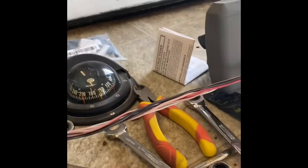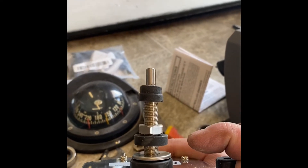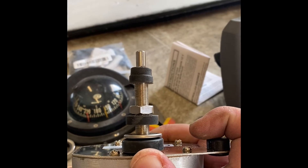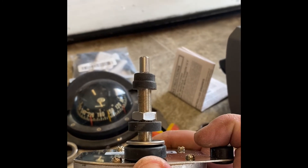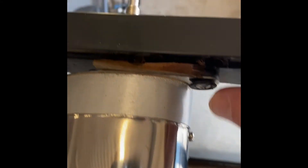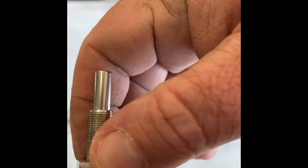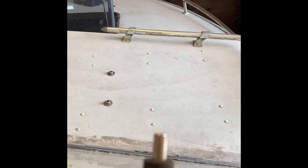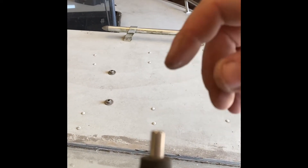For the new one, you'll have to pull the nut and all that off to put it back up and through. I'll show you installing it back in. I've screwed the screw back in, mounted it, put the rubber on, the washer, then the nut. There is another rubber cap here — just goes on like that for the wiper.